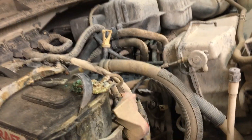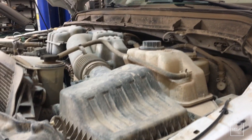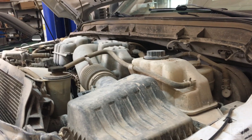It's an oil-field truck, so a lot of times when they bring me the trucks, they're really covered in a lot of dirt. This one's got a complaint of a misfire — this thing's running like a three-legged dog. Also, when I went to move the truck inside the shop and pushed the brake pedal, it felt like I really didn't have any vacuum. It was really hard to stop the truck — you really have to put some force into the brake pedal to stop it.